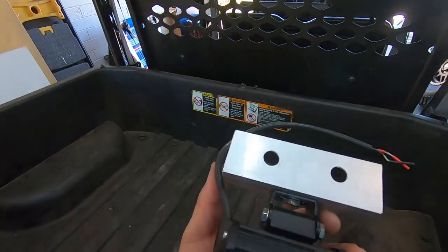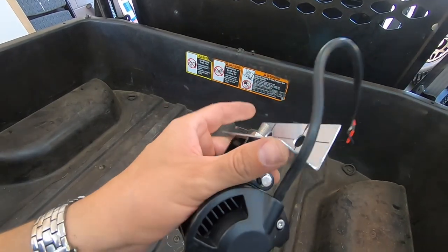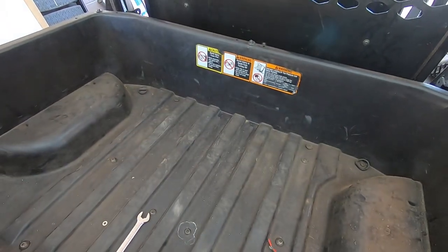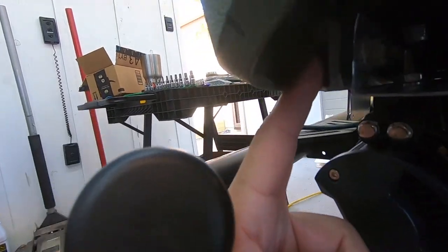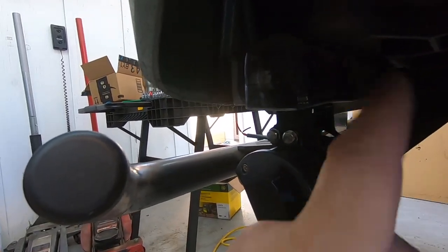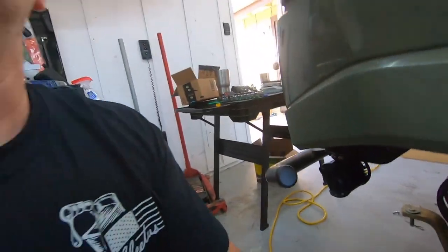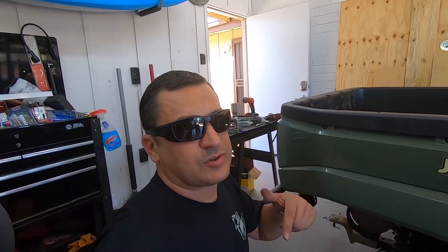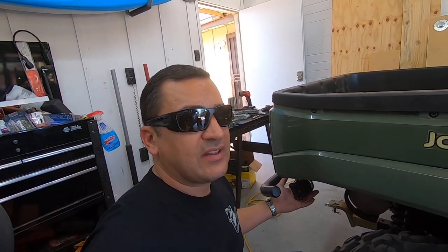Next I need to get the rear lights mounted and wired up. For those wondering how I built the bracket — it's a piece of two-by-two, eighth-inch-thick aluminum angle iron so it doesn't corrode or rust but will give if hit hard enough. I drilled two half-inch holes for a little extra play, then went to the bed, unbolted the existing 15-millimeter bolts, and slid the ratchet in from the back side — that's pretty rigid. If you have a better idea on where to mount these, leave a comment below. The owner isn't going to off-road it much — mostly just taking the grandkids for a ride.